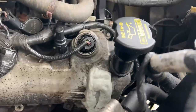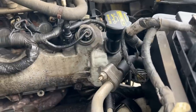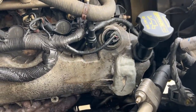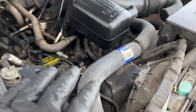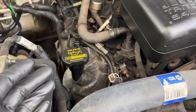When the chain lifts high enough, it makes contact with the valve cover. It'll crack a chunk of the valve cover off and start spurting oil out everywhere — it's all wet in here because of that. The customer put some JB Weld on there to cover it up so he could drive it onto the trailer. Once that chunk of guide lifts the chain and lets it back down onto the phaser, it actually mistimes the engine — makes it jump timing.